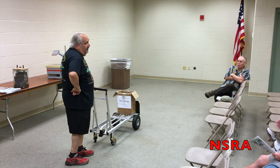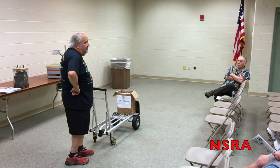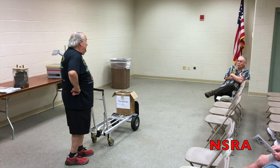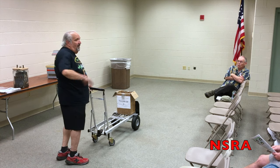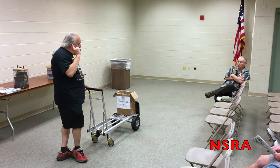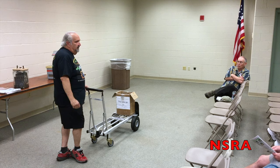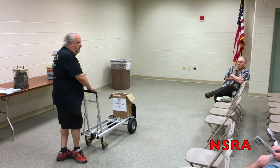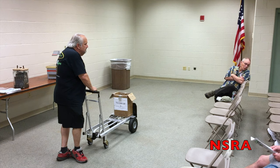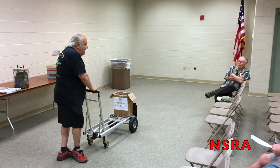That's why, like I say, a lot of people don't know that generators put out 2 voltages. They don't know that alternators put out 2 voltages, but they've seen it. When you start a car and it goes to 14.4, they can't leave it there very long. But that's on purpose to make bubbles. The reason they do that is for bubbles. It's gassing the battery. Can you jump start a 6-volt with a 12-volt? No. Not at all.